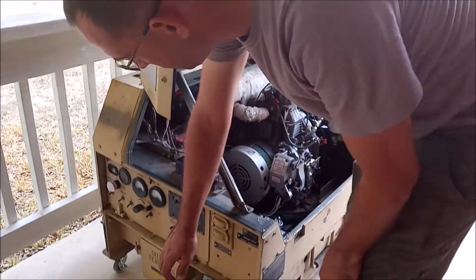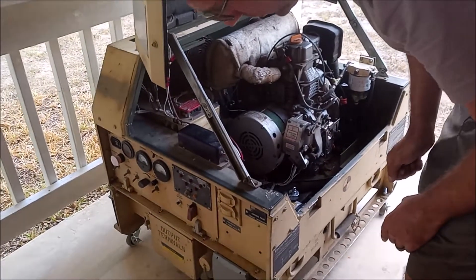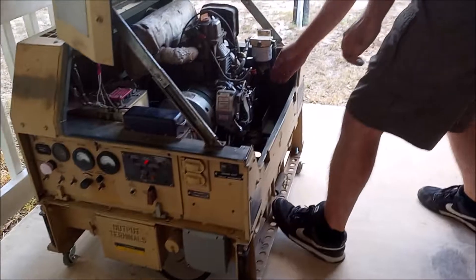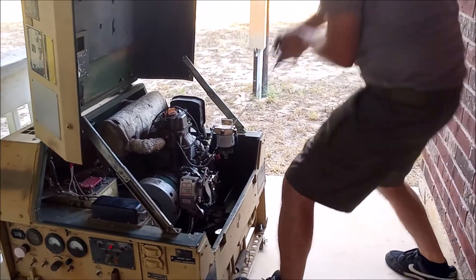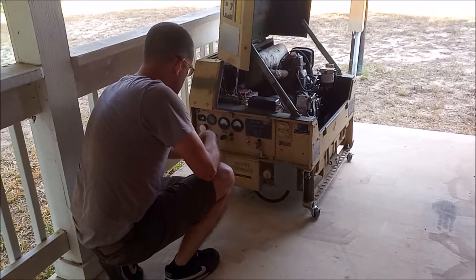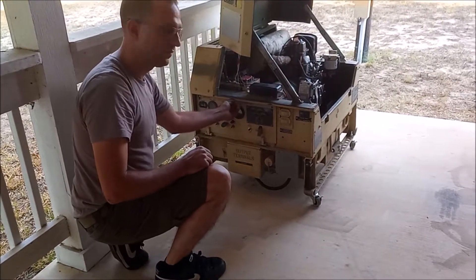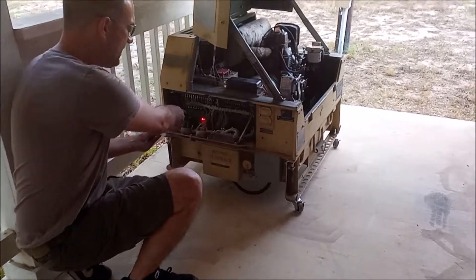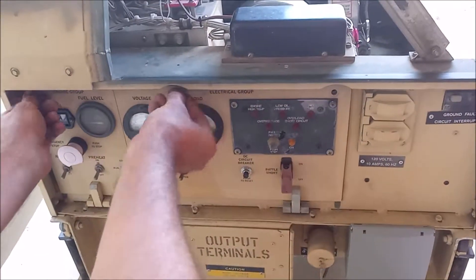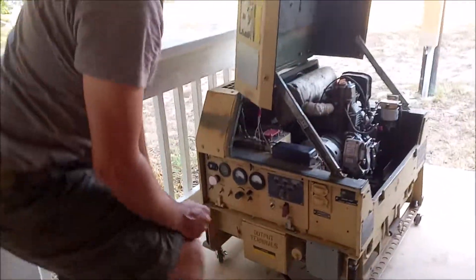I'm going to go through the procedure the right way. I already pulled this out, got to the point where it stops on the compression lever, let it back in, put the decompression lever down, the pin's locked — run. I don't have a lot of room here with the house but — yeah, power. And it shuts off. So the reason why I was having the problem is I wasn't doing the pull start procedure correctly.